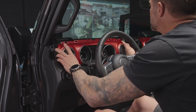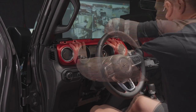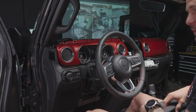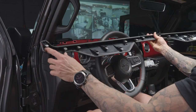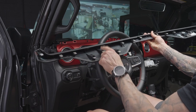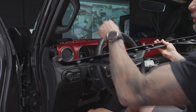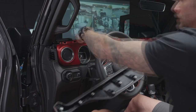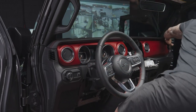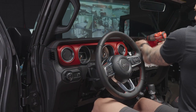Reinstall the instrument panel cover — it snaps in at the bottom and four screws go on top. Now install the main dash piece. Make sure all the metal clips are attached — there are two plastic clips at the very end and the rest are metal clips in the middle. If any aren't attached, look inside the dash. Push the panel in all the way across, then install the one screw for this piece.